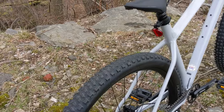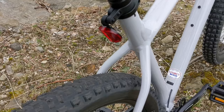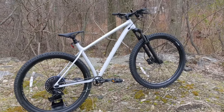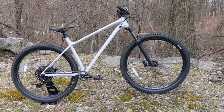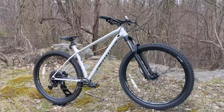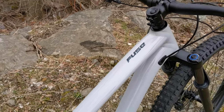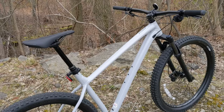The neat thing with this 2.6 is it's got a super huge amount of volume, and the aluminum frame can be manipulated so that it can still have pretty short chainstays and aggressive geometry even with these larger wheels. One of the advantages of a larger wheel is that the bike is going to roll over things a little bit better — the rock in front of that tire gets theoretically smaller the larger the wheel size.